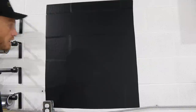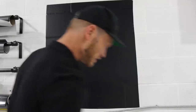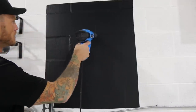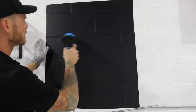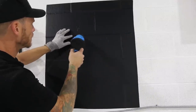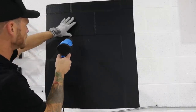Alright, that gives you a perspective of what this looks like right now. Now we're going to heat it — we're going to bust out our heat gun and heat this up especially in between all these gaps. I let the film sort of pre-shrink; when the film moves it's basically pre-shrinking and tightening down, and then we take our finger with a glove on and push into all these nice little gaps and recesses.